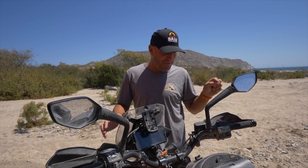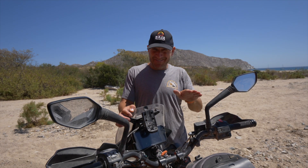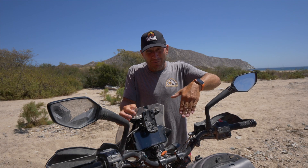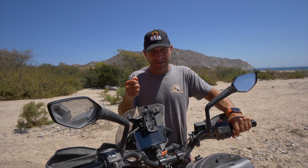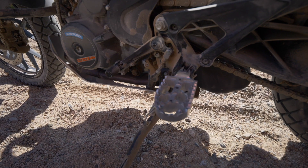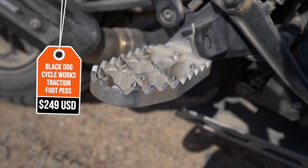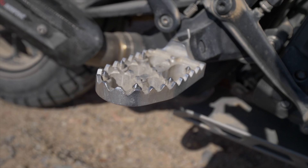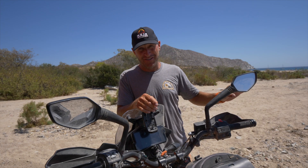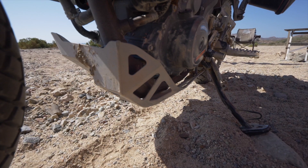Probably the first and biggest upgrade you can make on this bike is to replace the foot pegs. They are cocked forward from the factory — maybe 30% — making it virtually impossible to stand up and ride off-road. I upgraded to Black Dog Cycle Works pegs, which have a larger footprint and are much grippier. Do yourself a service and replace the foot pegs first thing.